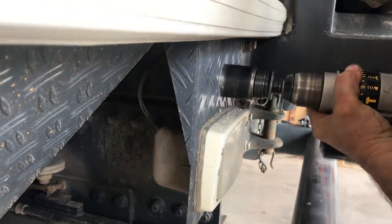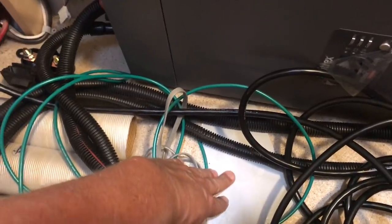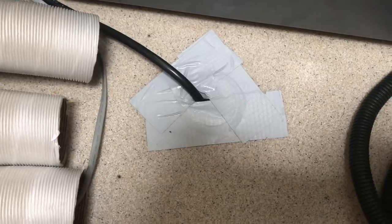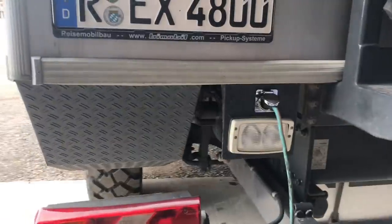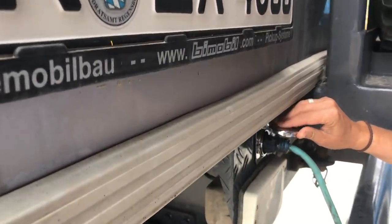We're going to go outside. We already have a conduit underneath here from the old air con — this was the outlet for the hose, a way to go out of the car. So we're going to route the cable out of the car and put the plug on the back of the truck. Then we can plug in at any house and charge our batteries with 110 volts.